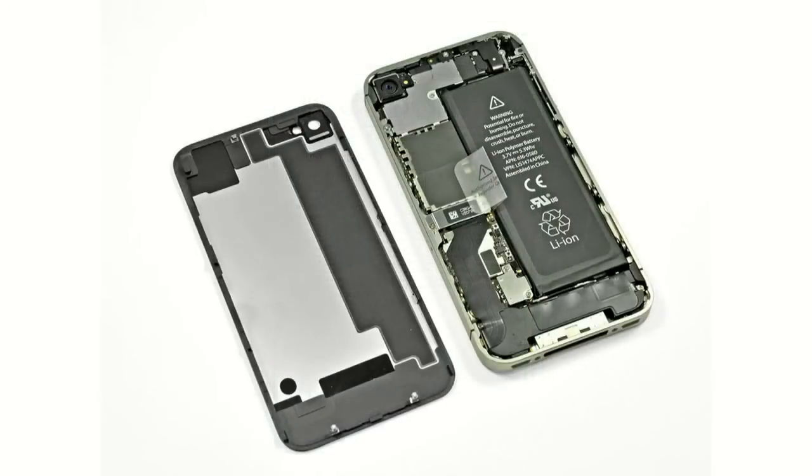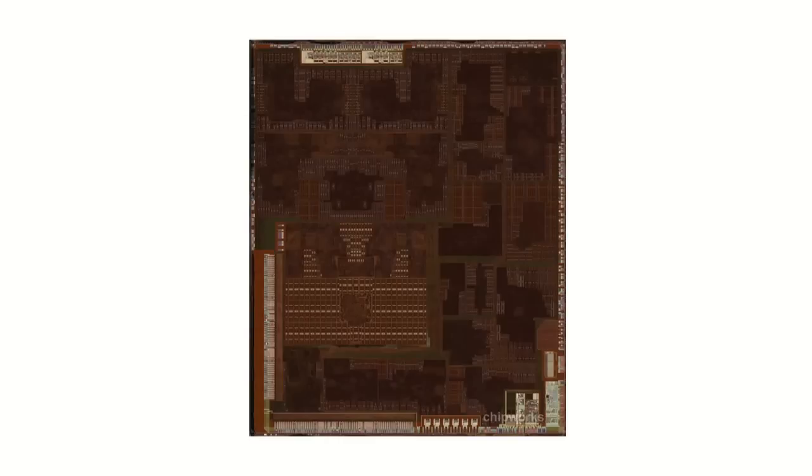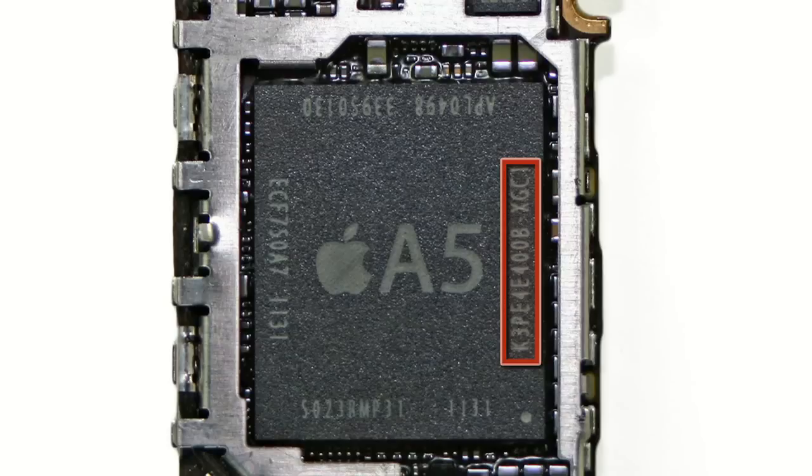The important changes in iPhone 4S are all on the inside. Apple now equips iPhone with the identical A5 processor used on the iPad 2. The A5 is a system-on-chip that integrates dual processor cores, graphics processing, and a lot of different interfaces all on a single silicon die. The processor cores are based on designs licensed from ARM Holdings, the British chip design firm. Almost all smartphones in the world now use ARM technology, so it's not unusual for their processors to be referred to as ARM processors, even though ARM doesn't actually manufacture anything. The A5 itself is currently made by Samsung, and the chip package also includes 512 MB of RAM on a separate silicon die.